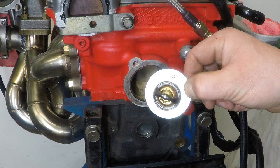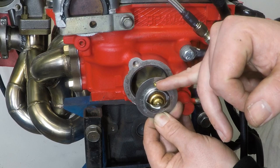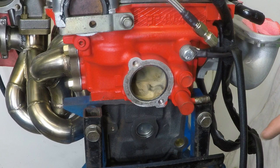I've purchased a standard 82 degree high flow thermostat. When installing this it needs to be in the upright position with the flow toggle at the top. Some people have advised me to cut this flow toggle off as it can produce a little airlock. Now all we need to do is make sure our surface is clean and we can bolt it all on.